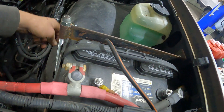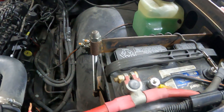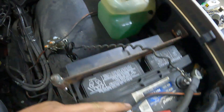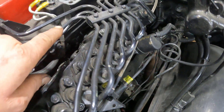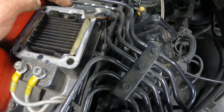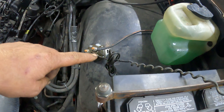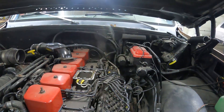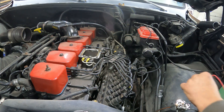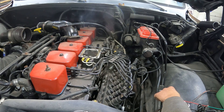Got this little wire done. Like I said, I ran this one already so I'm going to do it real quick. All right, so like I said we got this wire from the battery — positive — hooked up to this side of the solenoid, and from here we go underneath the injection pump and come back up right here. I hooked up the ground right there. I just ran that bolt in there real quick, and I hooked up a jumper wire right there, and then I've got another makeshift one here. We're gonna check and see if the solenoid works. You'll hear it clicking — that's the solenoid engaging.